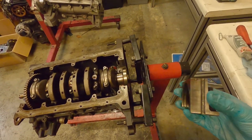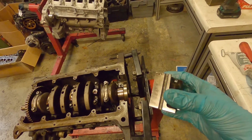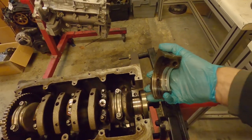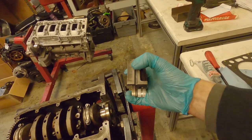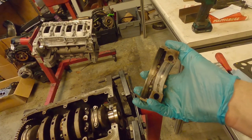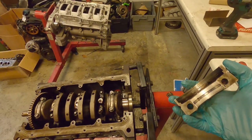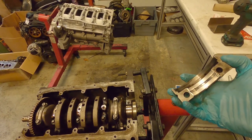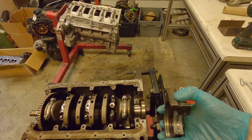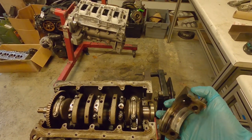On this engine, the last cap has a silicon seal on it. You can see these grooves in the side — you need to be sure you've removed all the old silicon and cleaned these surfaces as best you can, and also cleaned out all the old silicon from the block. You're going to run a bead of silicon down this groove. This surface here is sealed by the sump gasket, and the other surface should be a complete flush fitment against the block. You don't want silicon getting into your bearings, because that will raise your bearing up.